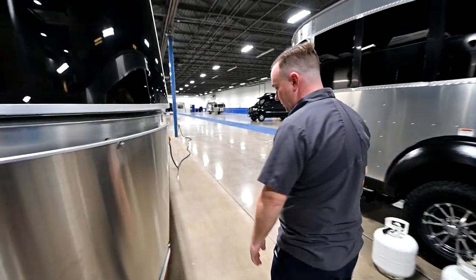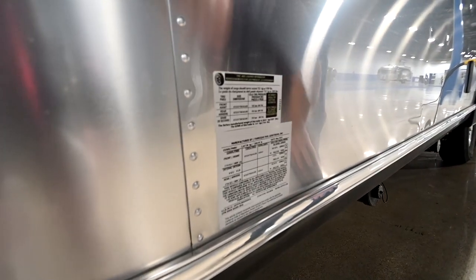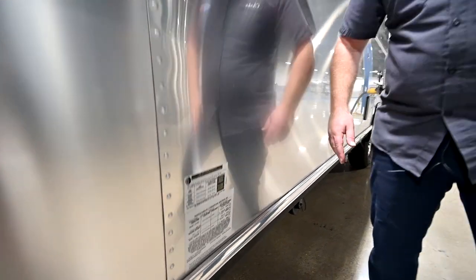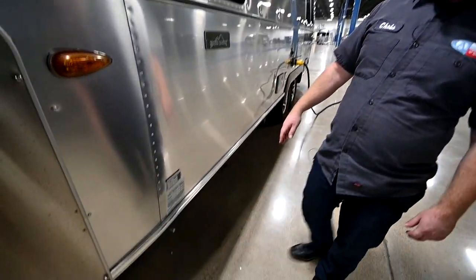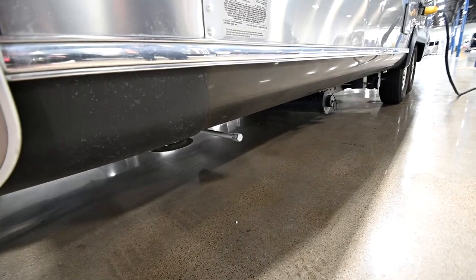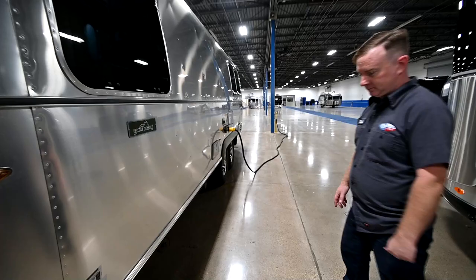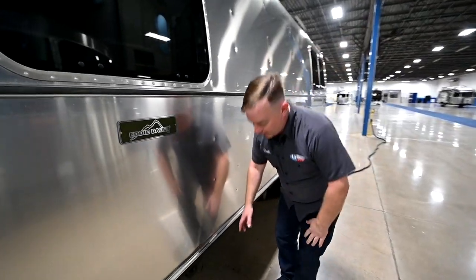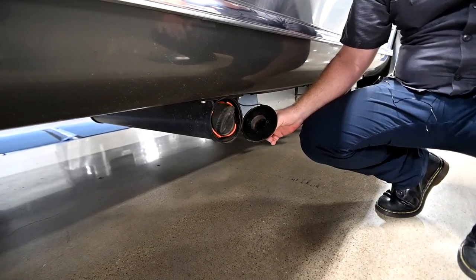Come around the corner here. We've got your gross vehicle weight and tire pressure sticker here. It's 80 psi on your tires — not 65, I'm sorry. This stud here and its friend down at the end will drop your stabilizer jacks. You do have an independent stabilizer jack control for each corner of the trailer. Storage for your sewer line is here — this tube is going to hold a collapsible 15-foot sewer hose and there's one already in there for you.